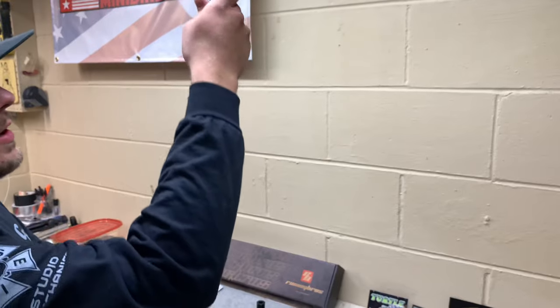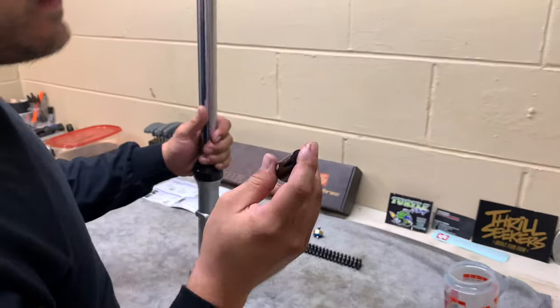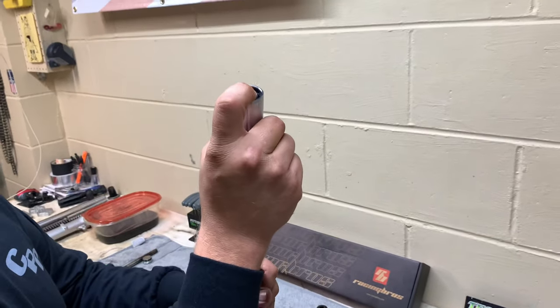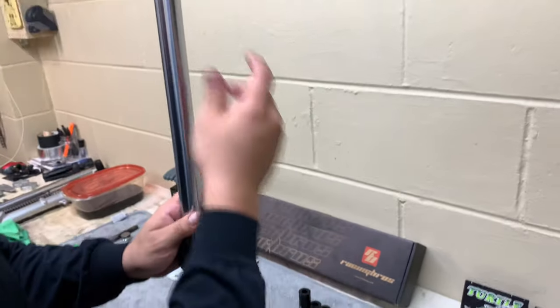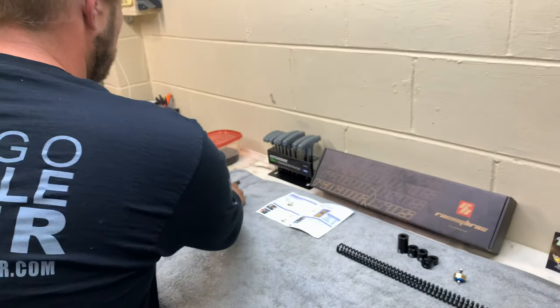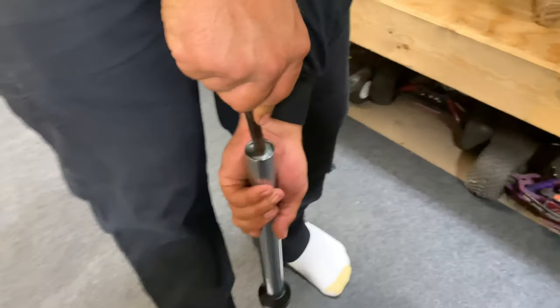Take the spring that Racing Bros supplies and toss that on top. Then put this spacer right there. Now if you want more preload, you can take another one of these spacers and shove that on there too — if you don't think they're hard enough or don't have enough preload, just stick an extra one on. So far we've only done the one. This is actually not as intense to put on as with those really hard stock stiff springs.